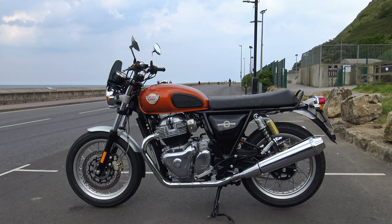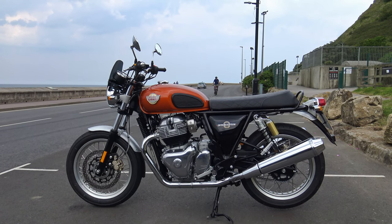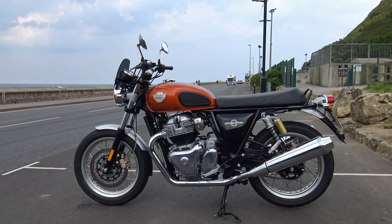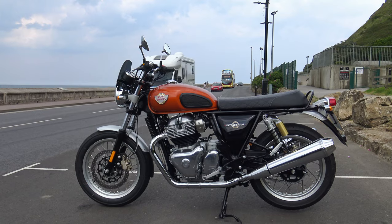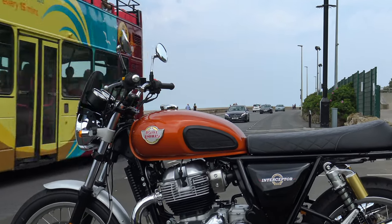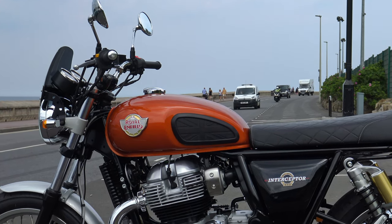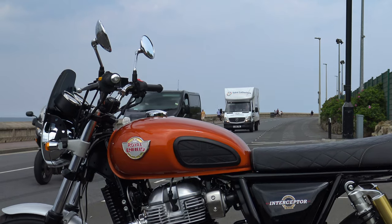Here are the main points. On the original Triumph version, it relied on two clamps to hold it onto the frame at the rear — basically a friction fit, meaning if it got banged hard enough those clamps were capable of sliding backwards. There's enough flexibility in that flat-plate sump guard to allow that. The saving grace for Triumph was a proper bracket at the front which limited this movement, but it was still a compromise.